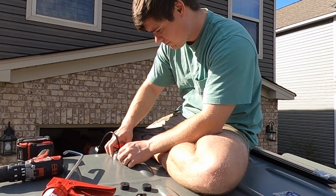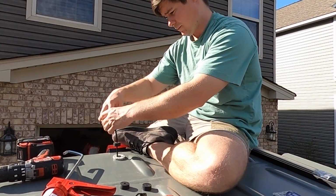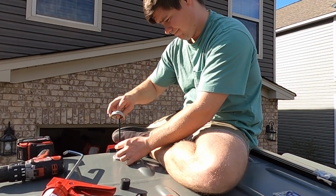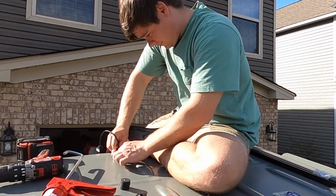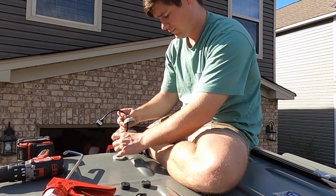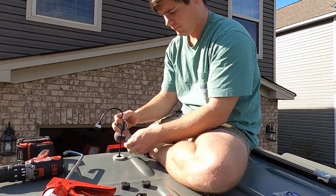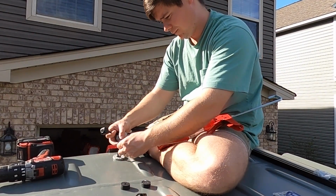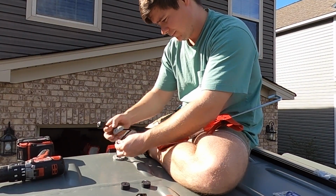So far, it looks like the combination of the wire size and the ability to fit the camera through it, all that, the through-hole fitting worked perfectly. It's a super easy install. Just went inside the van with a 3/4 inch hole saw, drilled a hole up through the roof, and then installed the through-hole fitting with 3 screws that hold it down.